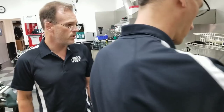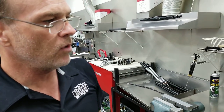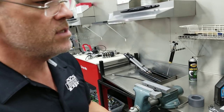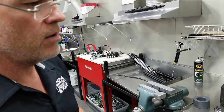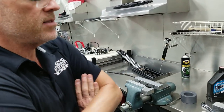Just a simple word of warning, there's 3 bolts that hold that electric motor onto the pump reservoir. The 2 lower bolts are long and have lots of threads. The upper bolt is long but for some reason has only 3 or 4 threads from Honda. By nature of good mechanicking skills, we always thread the longer bolts in first to grab that, and do the long one that only has a couple of threads last.